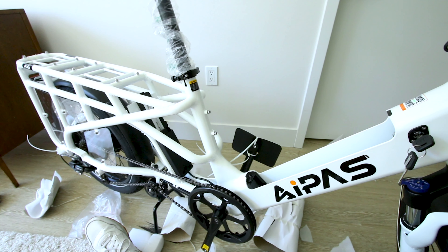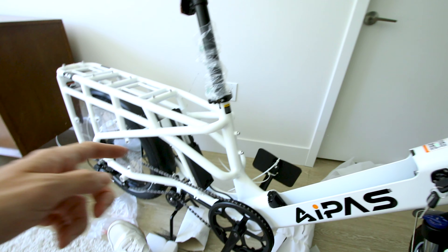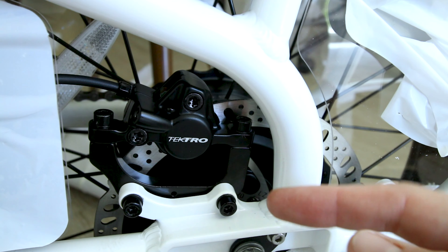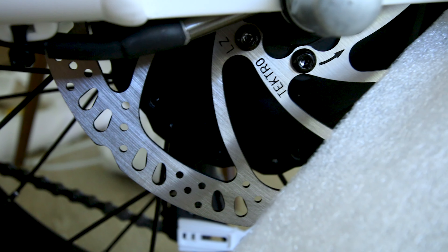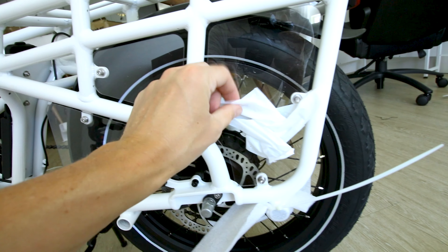So 25 times 54 is about 1300 watts peak power on a full charge, flowing from the batteries through the controller to the motor. Here's the pedals that come on the bike. You get Tektro hydraulic brake calipers as well as 180 millimeter Tektro rotors — all around excellent brakes on this bike.